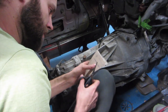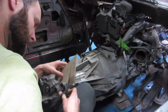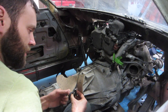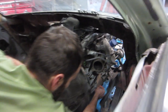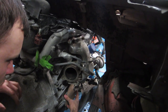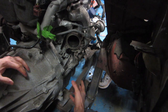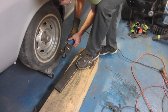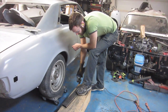Tony's just starting up on the engine mount mock-up, using some cardboard to figure out placement. This would be the plate that will directly bolt onto the engine, and then we'll build our bracketry from here out to have our engine mount somewhere around here on the Miata subframe. What do you build in there? A trans mount — it's a frame brace kind of in one there.